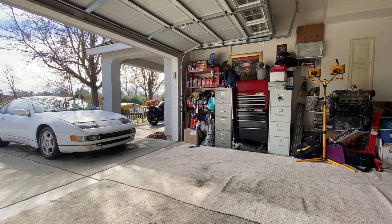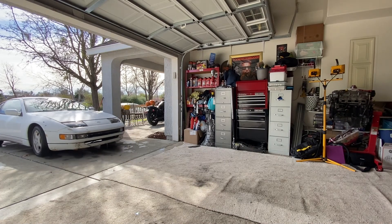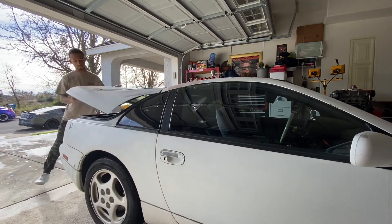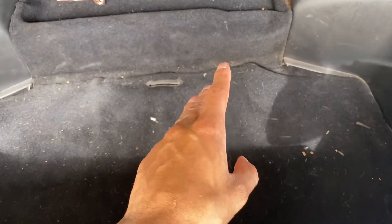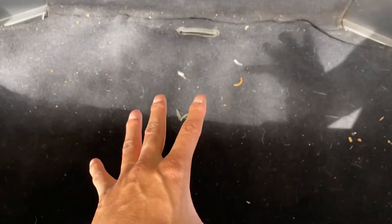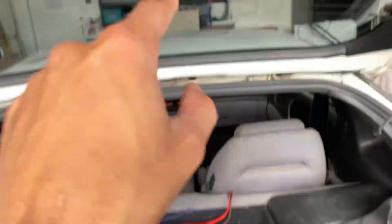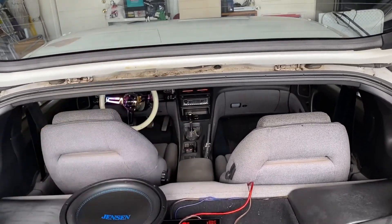Here's the process: I'm going to pull out the carpet from the trunk, lay it over the solid piece of wood, trace the outline, cut it out, and place the wood in the trunk without the carpet. Once the hardwood is in the trunk, I'll trace where I want the sub dead center, cut that out, then measure and cut the same hole on the vinyl rubber mat — the fake hardwood — and mount the sub flush into the trunk.